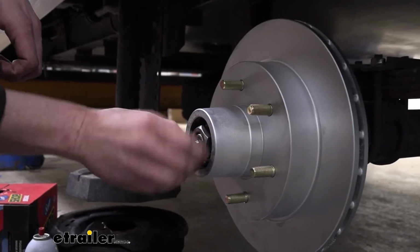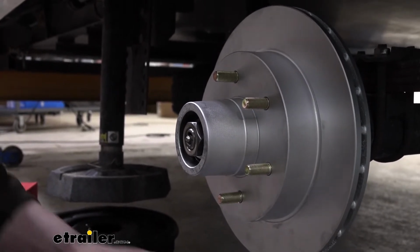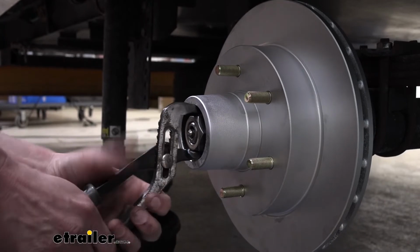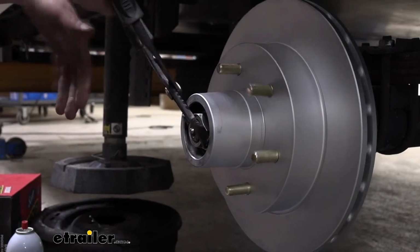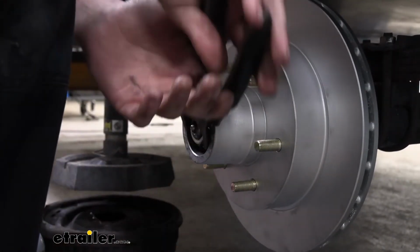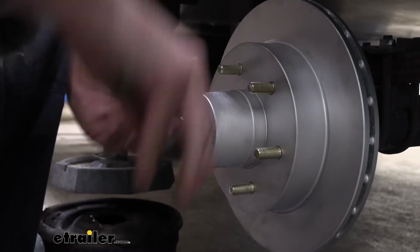And then after we get our nut on there, we're gonna use the nut to ensure that this is fully seated. So grab your channel locks, go ahead and clean any grease off at the end of those. And then just go ahead and tighten this down. Now we're gonna tighten this fully. This isn't where we're gonna leave it in the end. So again, we're just trying to make sure we've got all of our components fully seated. And I like to just kind of spin the rotor assembly with it just to make sure everything's kind of sliding and falling into place.